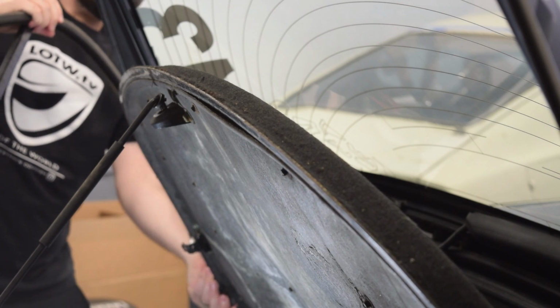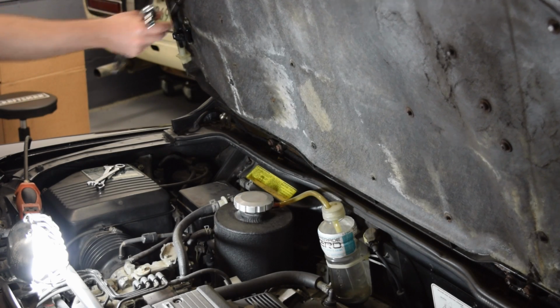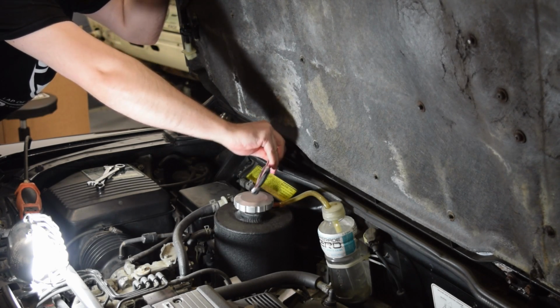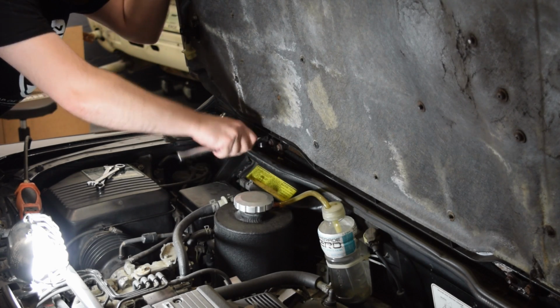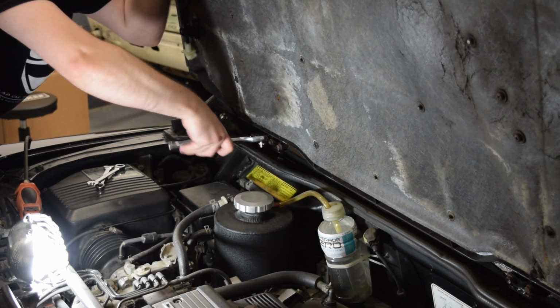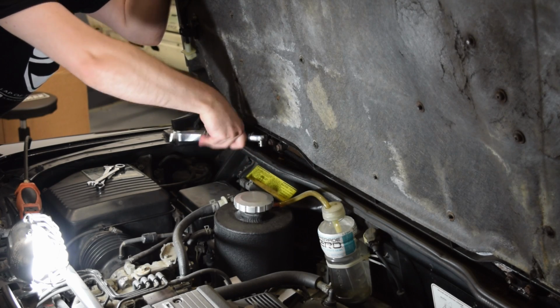Next, remove the 4 bolts affixing the engine cover to the bulkhead. Fortunately, they did not put up much resistance in spite of their appearance in my case. I suspect in most situations a 10mm box wrench will do the trick to get them loose. If you do need a small ratchet handle to get them started, like I did, the cover will raise to nearly 90 degrees, enough to get a socket onto the bolts.